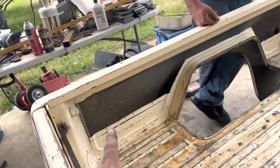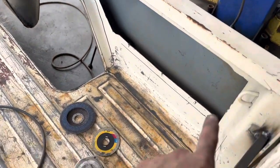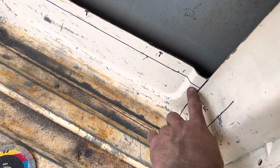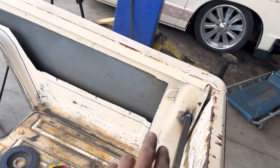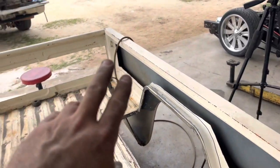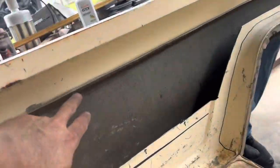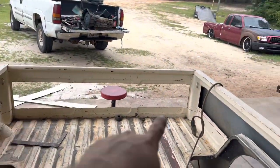We got the sides cut - just cut rough around the fender well because we're not keeping any of that. We took seven inches out from here to here, and this is the eight-inch mark. I'm going to grind most of that and leave a little bit where we have some marks to line up all the way around so when we get ready we can weld it. I already ground this before we started and the front I've got to grind it top and bottom.